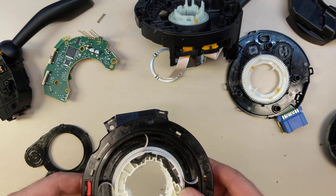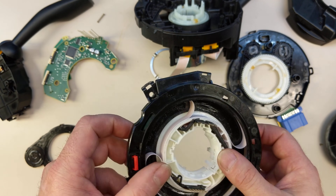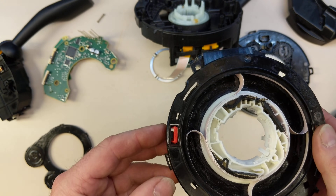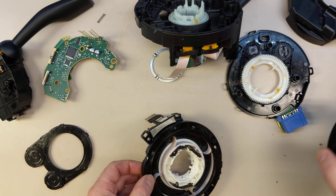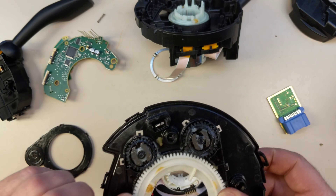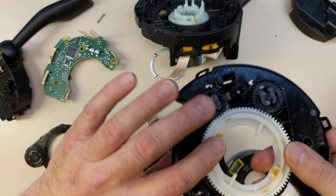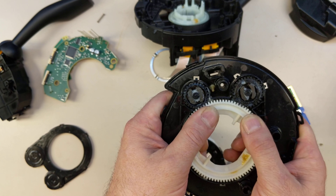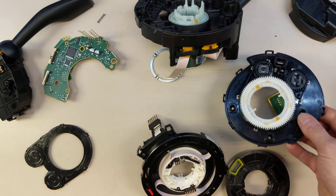I mean, it looks simple, but there's lots and lots of care put into these. It looks like no less than eight pieces of injection molding in this alone — maybe 12. And these gears, to make sure this is really accurate, there's a preload spring on here that pushes this nylon gear to mesh with this so there's no slop. So the tiniest movement affects these magnets. Really cool engineering here.